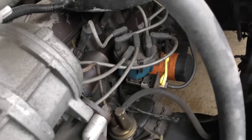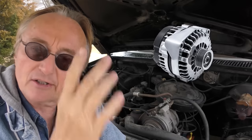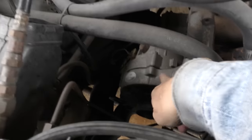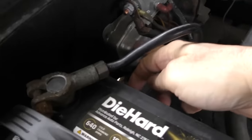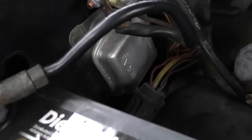Strangely enough the air conditioner still works on this old thing. Pretty much everything is simple: there's a mechanical fuel pump that bolts on with two bolts, a distributor system that can easily be repaired. And this is one of my favorites — don't you hate it with newer cars where your regulator's broken but it's built into the alternator, so you've got to replace the whole alternator? Well not in these old things. Here's the alternator, and here's the regulator over here — you can replace just the regulator, it's a separate piece.